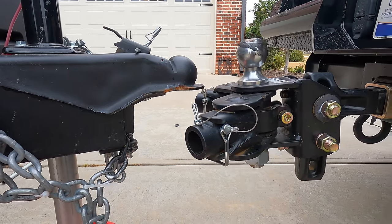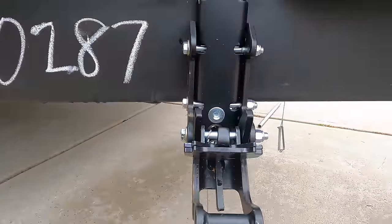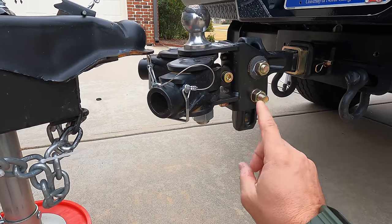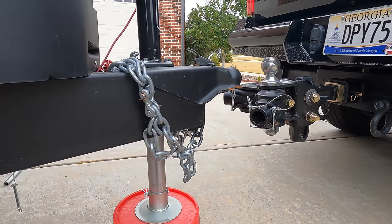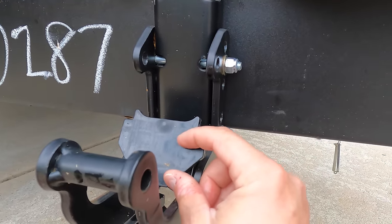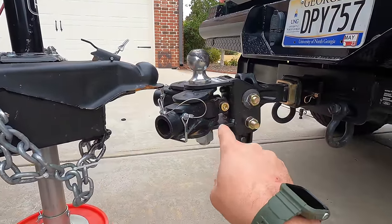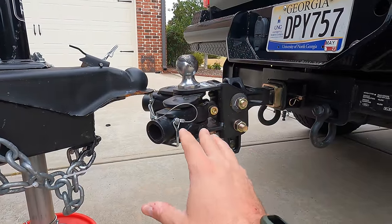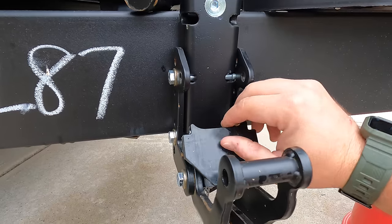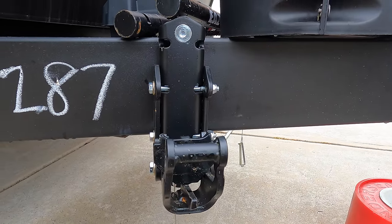The build score would be really good. Back here at the saddles, there are a couple things I really like and a couple I don't. One thing to note: this brake material will eventually wear out — that's one con, though I assume it would take tons of miles. Back here, one con is this piece is plastic. That's what makes this hitch silent — when the bars are moving across here, the friction is in the brake material, so it shouldn't make any noise. Just like good brakes on your vehicle. The bars are free to move back and forth over this plastic material, and yeah, this thing is completely silent.